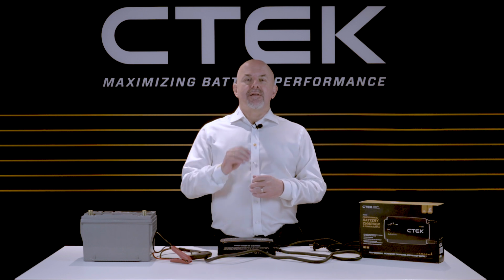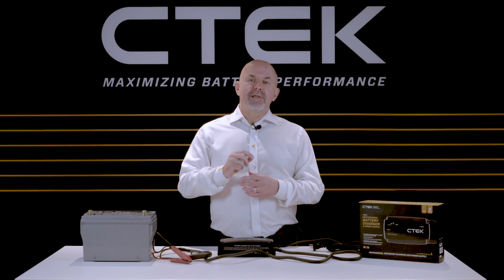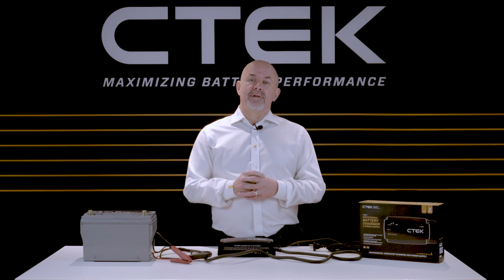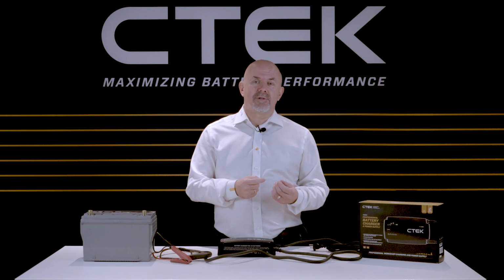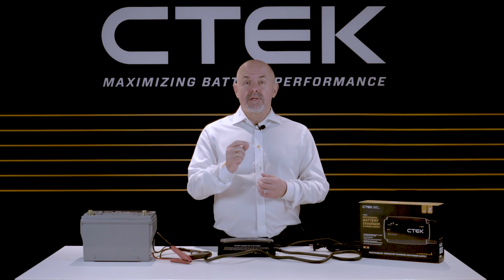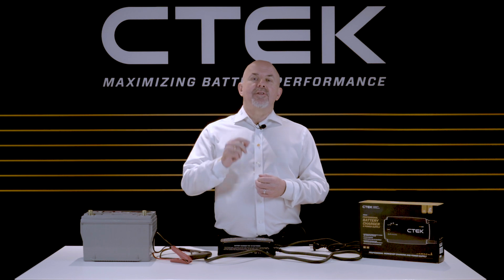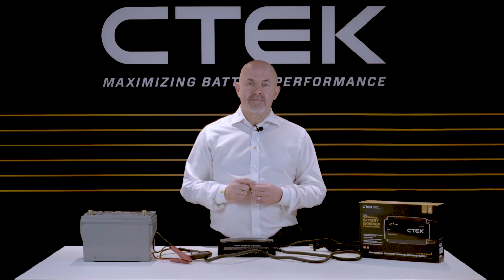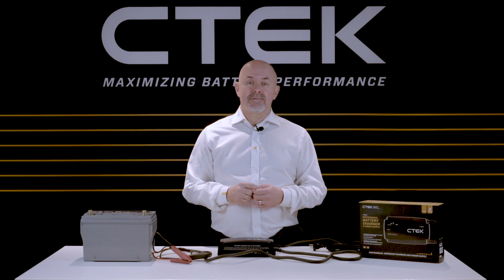Please remember that if you're connecting the ground or earth to the vehicle, they must be connected to a suitable point on the vehicle's bodywork. Different vehicles nowadays might have specific charging points. So if that's the case with the vehicle you're working on, take a look at the vehicle owner's manual. That should tell you the correct charging procedure for that particular vehicle. Right, let's get back to charging this battery.